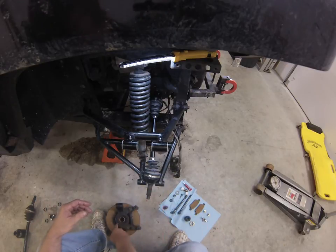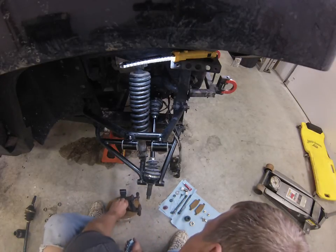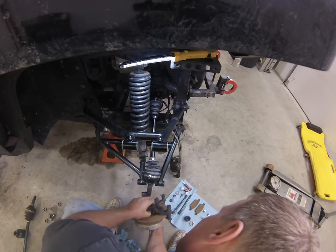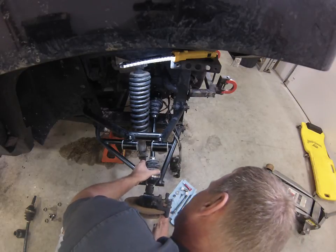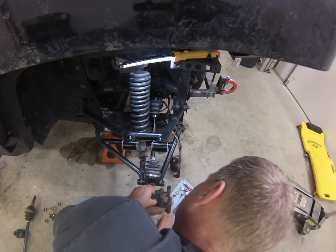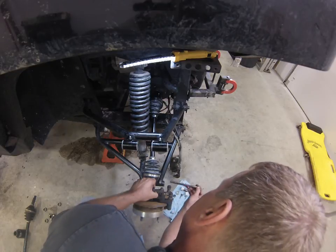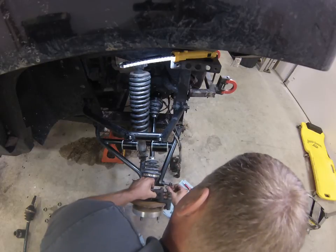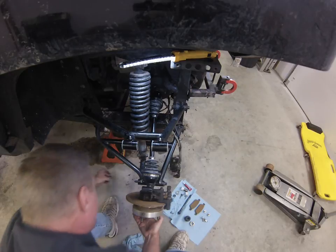You just have your axle shaft that goes through here with a spline. You'll find you can just put this together like this. If I can hold it, axle shaft goes in the middle. Get the bottom started in there. Axle shaft started in. Slide the bolts through the bushing, through the lower suspension. And the bushing pops out.